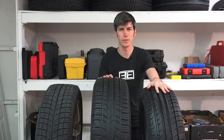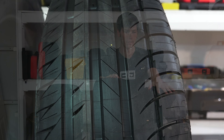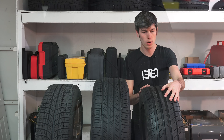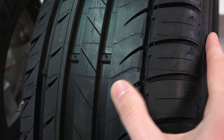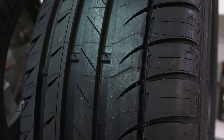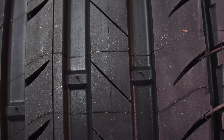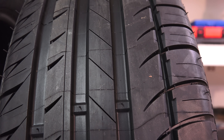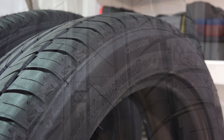Let's start by looking at the tread features of the summer tire. You'll see a continuous center rib for good straight line stability, and a large contact area on the outside of the tire so that when you're cornering it's got a lot of contact area to grip the road. Summer tires sometimes have less tread depth overall, which helps with steering feel and responsiveness. Overall you'll notice a lack of tread features compared to all season or winter tires, which is really good for dry grip. Summer tires also tend to have stiffer sidewalls, which can reduce comfort but allow for better steering response and feedback.